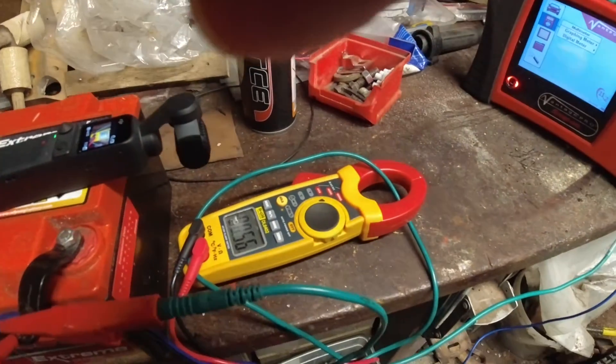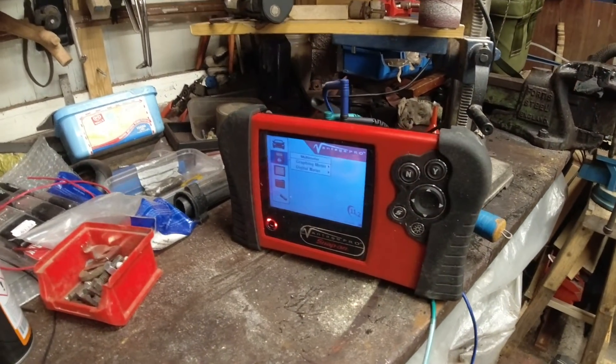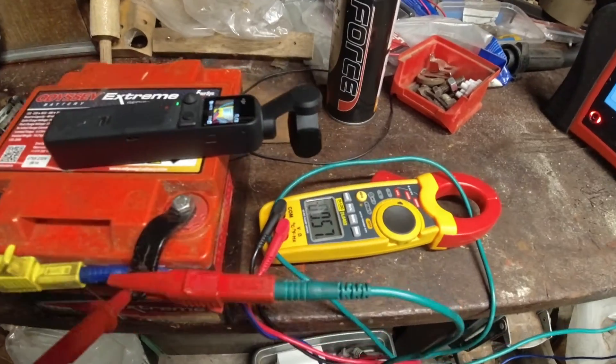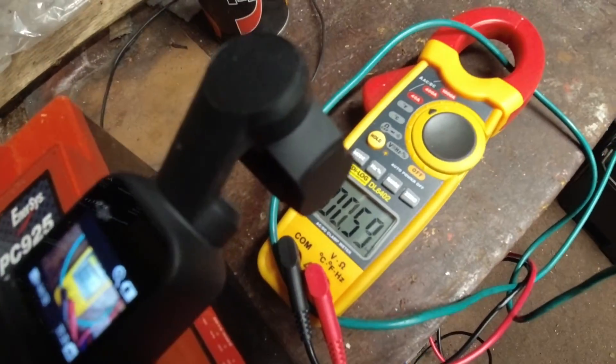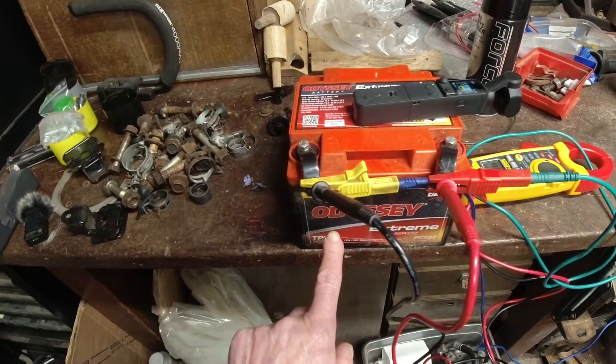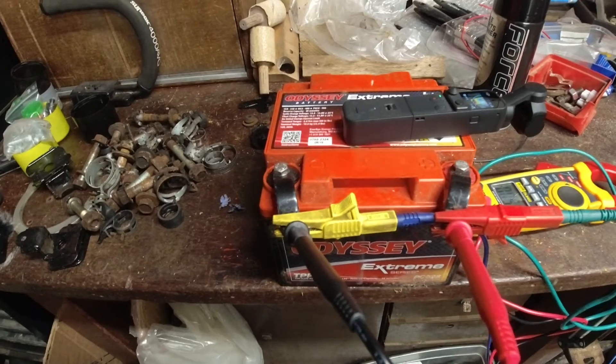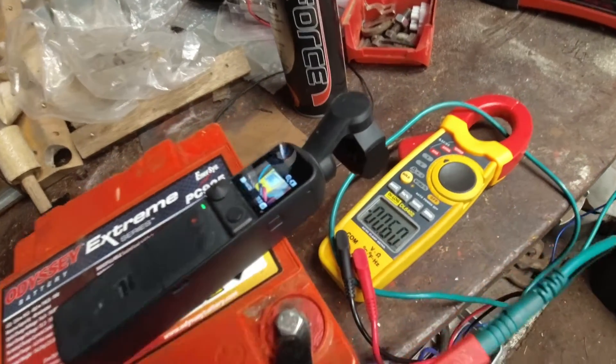So you're going to watch a video in the next couple of minutes where I have an amp clamp, a battery and the multimeter all set up to show you what's going on. I've got the amp clamp which has got 0.6 of an amp drain on it at the moment. This is a fresh battery that's been charged today and then left for about an hour before I set this little experiment up to show you how these batteries drain with a small discharge on them.